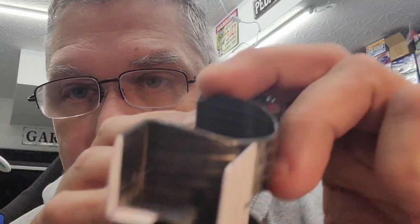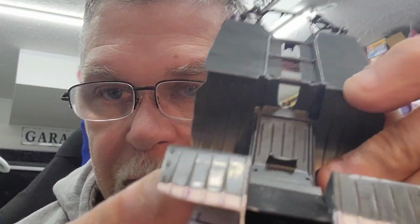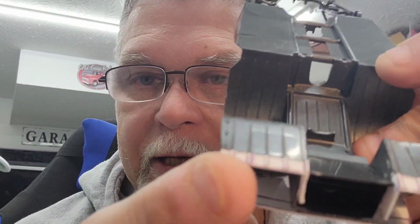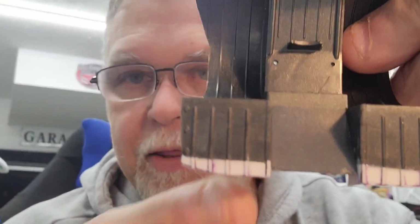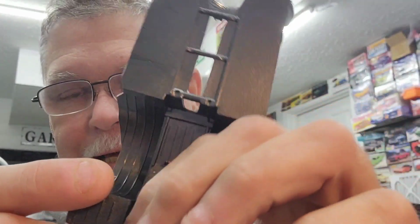I'm not rushing it. Like I said, right now it's time that we've done mocking up and we've done some fabrication to go back and clean all that up. That way this is all ready to be primed. I got in a hurry. I cut this too soon. So I had to go back and add material in. And then I shaped it to match the Mustang. And then I added the little ribs, like you see here, down these, and the little pieces here. We've got our center plate already in.